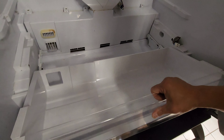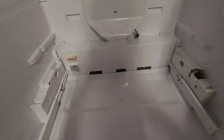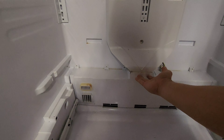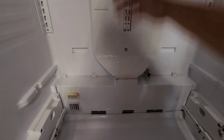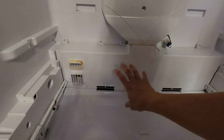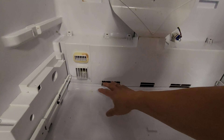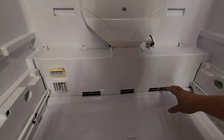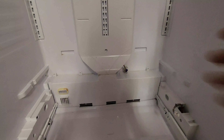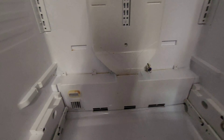Let's remove this one. What happened here is because the fan is not blowing up, the whole bottom of the unit is iced up — the whole thing is ice with frost. When the thing was broken, I defrosted it but the water won't go down to the drain hole.